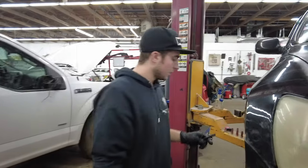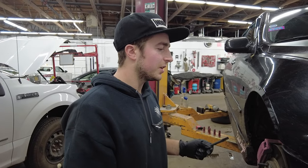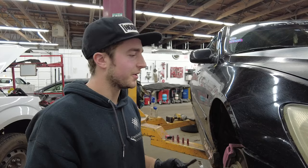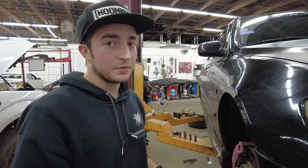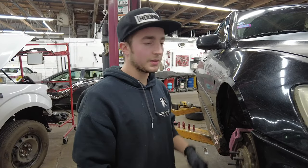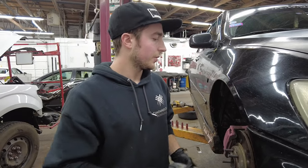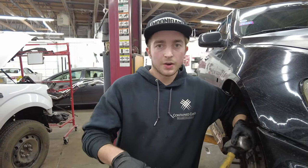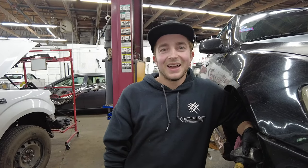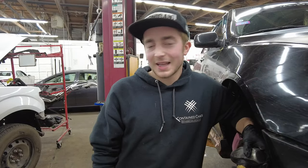One of the things I really like to do is, they say you shouldn't tighten your coilovers too tight, and I now agree with that. I used to not trust it. I have really nice BC Extreme Lows with Swift springs and all good stuff. And I got sick of raising and lowering it all the time when doing a test and tune day on my car, so I would just crank it. I'd crank it down as tight as I could, and as you go on, it wouldn't get looser, it would get tighter.